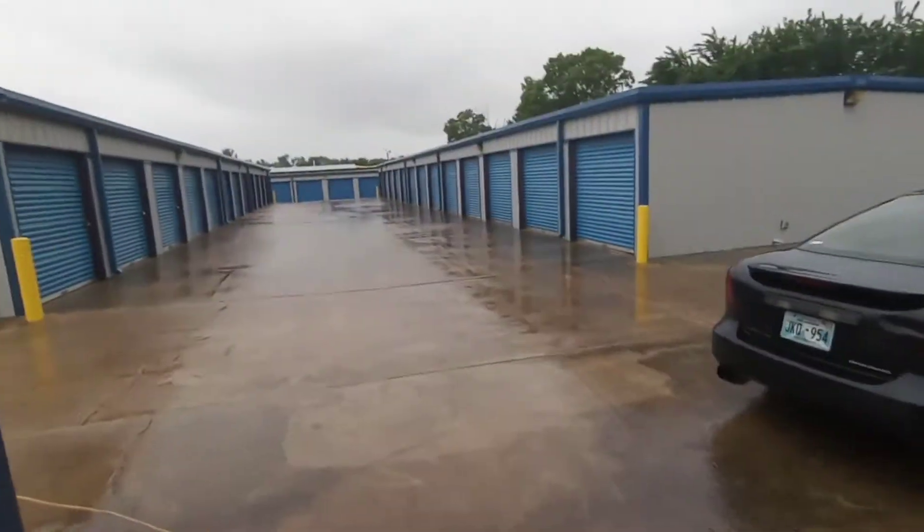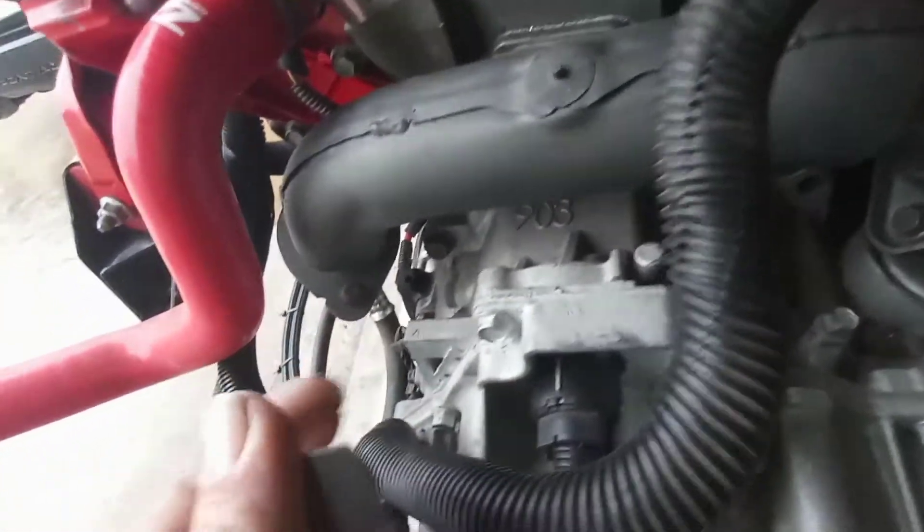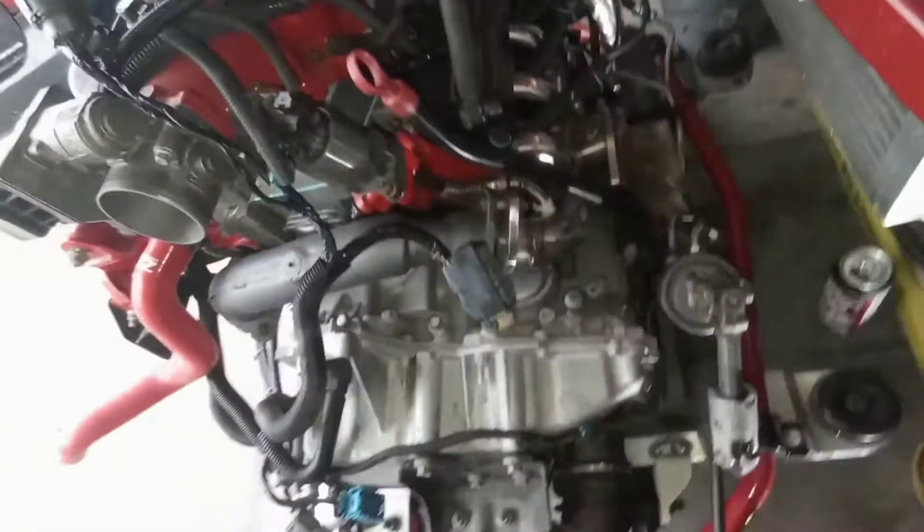It's Wednesday June 8th and I'm working on this. I got my new EGR block-off plate off eBay and I've already tested it — looks like it's gonna block that perfectly. I'm going to put some RTV on there just to make sure it seals all the way since it doesn't have the little piece that actually goes inside the hole. I've already got the EGR unbolted from the head, and now I just got to get that one bolt out.